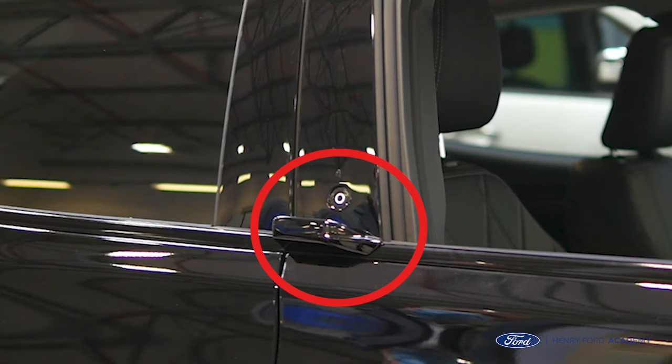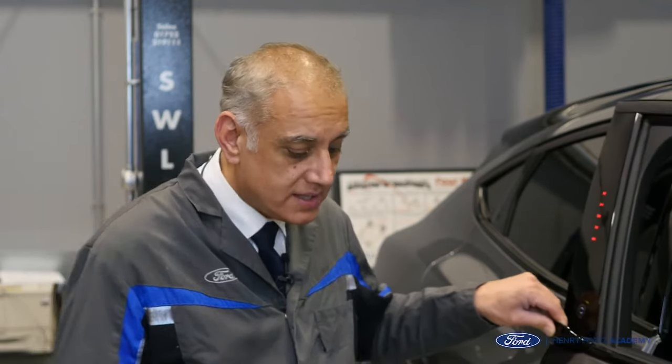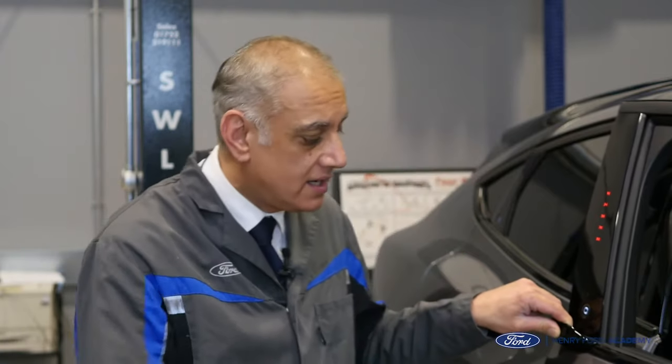Here at the driver's door there is clearly no key barrel within the door system. The system is designed so that the door control module inside the door has an extraordinarily large capacitor that will always charge itself up. In a situation where the 12 volt battery has become discharged, the door control module capacitors will still hold charge — they can hold charge for 48 hours. With the key in possession, simply press that button and using the energy inside the capacitor the door opens. We're allowed 20 door opens before the capacitor becomes discharged.